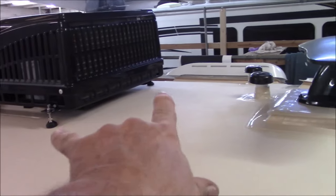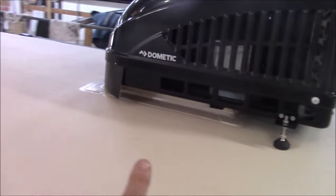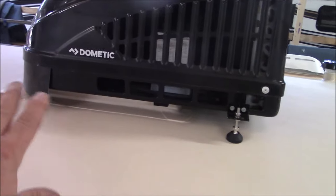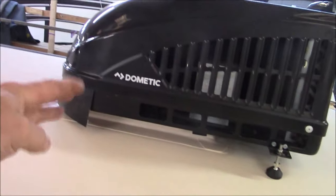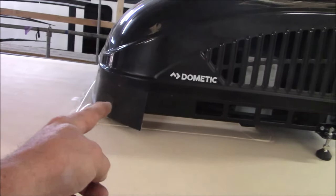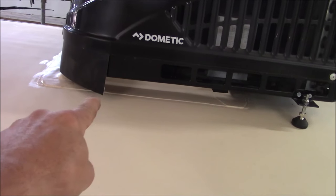And then you can see we made a nice curb for the antenna. And then you got these stands in the back that help give the air conditioner some balance. We did change out the gasket up underneath there. We do that to all of them. We replace that. Now, getting back to the rainstorm, here comes the rain trickling down, and I don't want the wind to blow it back into that foam gasket up underneath there. So I put yet another piece of counterflash that goes under the hood of this, and it goes over the counterflash of my curb. So now it gets pushed down below that, and it gets run out, so it doesn't interfere with the foam gasket.